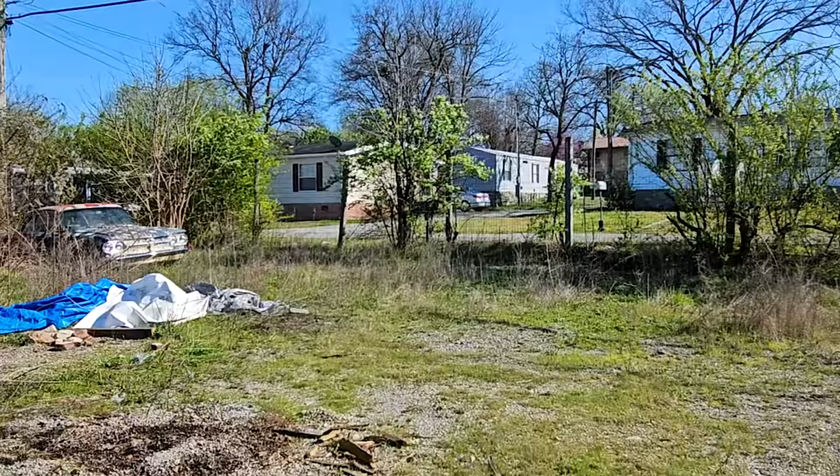Well, we made it to our storage lot. We're not gonna make it all the way home, unfortunately. Keeps getting hot over and over. It's circulating. The thermostat seems to be opening, so I don't know. I'll have to do a pressure test or something down the road.